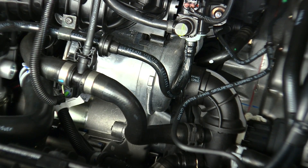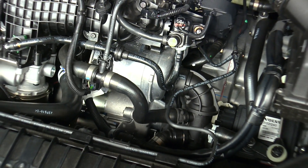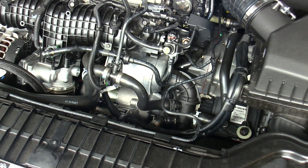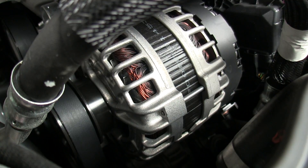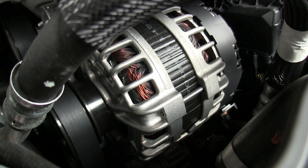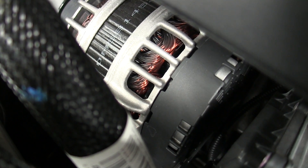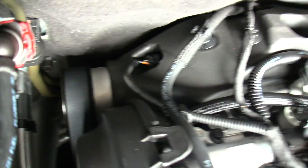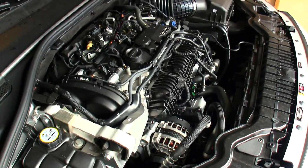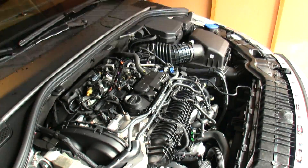The engine features other efficient components such as an electric water pump and an alternator decoupler. The electric water pump is variable, allowing for optimal power consumption unlike traditional belt-driven pumps which are typically always running. The alternator decoupler allows for the alternator to be decoupled upon acceleration or when it's not needed, and coupled under engine braking — essentially making it regenerative braking. Volvo chose to use both the supercharger and turbocharger so that there was an immediate response upon pressing the throttle pedal, and efficient higher-RPM power once there was enough exhaust gas to take advantage of the turbocharger.